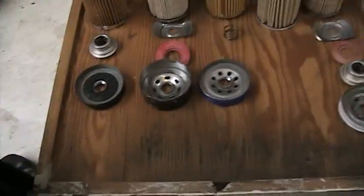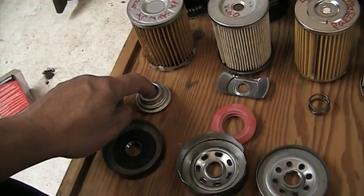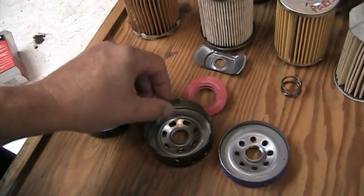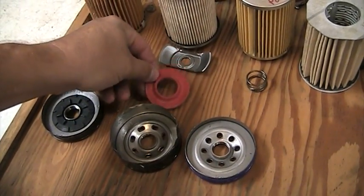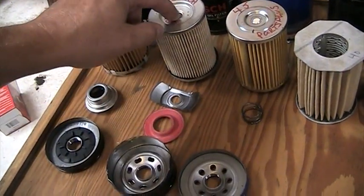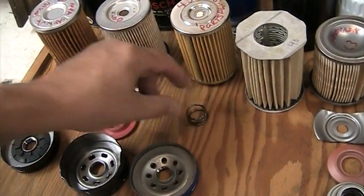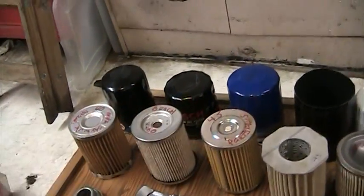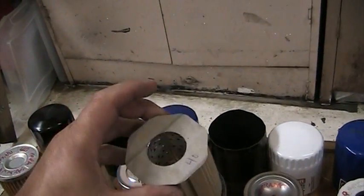As you can see, all the different parts that each one of them has. Some have new valves, some have just a cheap silicone drain-back valve. Some have these leaf spring type pressure regulator springs, and some have an actual coil spring that goes on top. Then you'll have some that have a little valve on the top, and some are all the way through, like the Micro Guard.